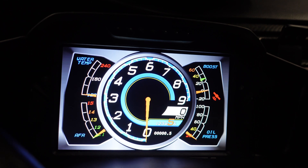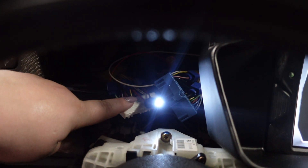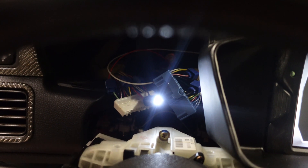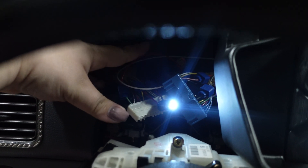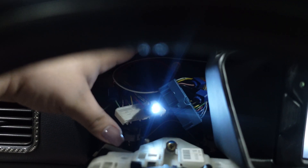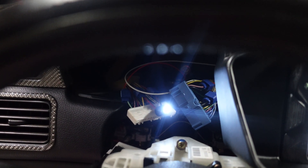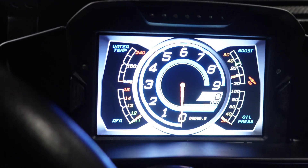This light you're seeing here — in the last video during the VDM install I mentioned the alternator was going bad, but it really isn't. There's a battery light in the OEM dash, and the two wires that we connected together have to have a resistance. So we connected this little LED light right here to act as a resistor — it turns on and completes the circuit, allowing the alternator to work. The reason it wasn't working is because the dash harness wasn't connected straight into the OEM dash to complete the circuit. We also wired the dimmer switch so when the headlights turn on the dash will automatically dim.